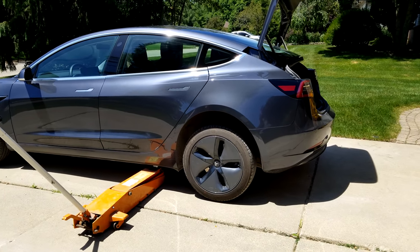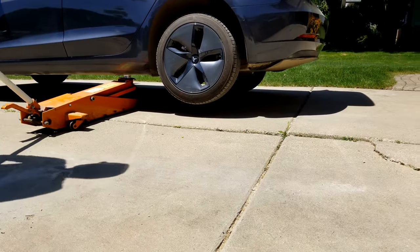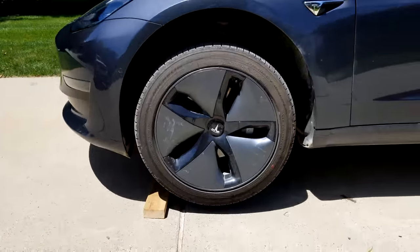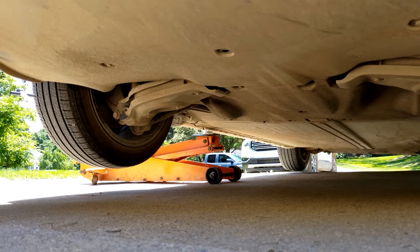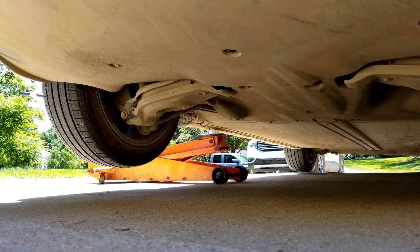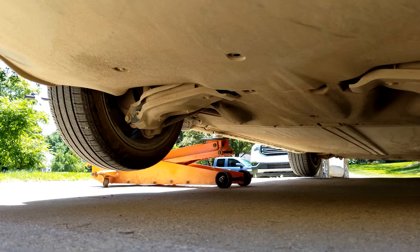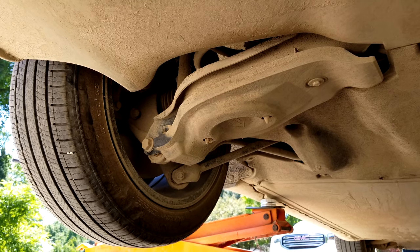It's heavy. We've got the parking brake on and a two-by-four in front of the front wheel. It's lifting the front tire too — yeah, that's what it's going to do with the whole side. We got a jack stand in place. This is the whole rear knuckle assembly; all this cast aluminum holds the bearing and everything. There's the shock absorber right there. The suspension is pretty basic — looks like a multi-link setup. Let me see if I can get a jack stand in that area.